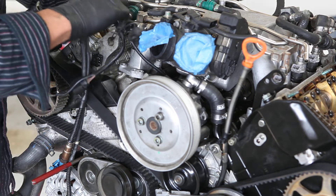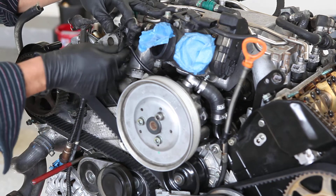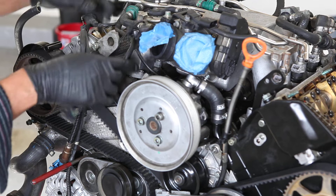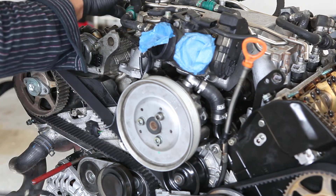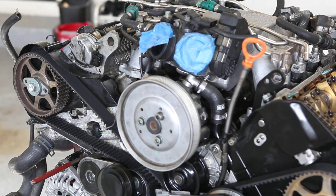Now I'm going to put the intake manifold bolts back on — let's just hope I don't have to take that out again. I still haven't tightened the head bolts, which I'm saving for last, because that's kind of a no-return deal.